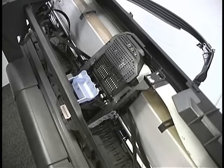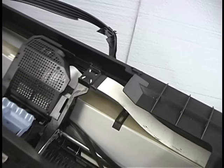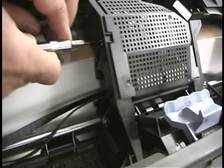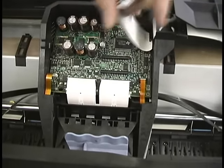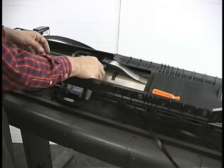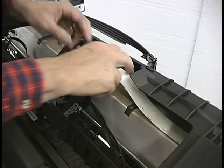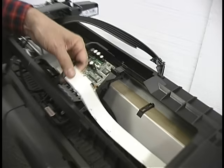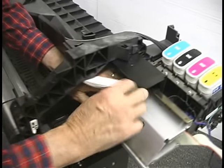The next thing we need to do is take off the trailing cable. The trailing cable is this piece right here. There's a latch on the side here — if you just push this in, this will pop up and come off just like that. Now we can easily undo these. There's a little plastic piece here — half the time it breaks when you try to take it out; that one didn't break, it just went into orbit. There's a finger underneath here — we can pull this loose — and I generally run this out the end of the machine so we don't damage it.